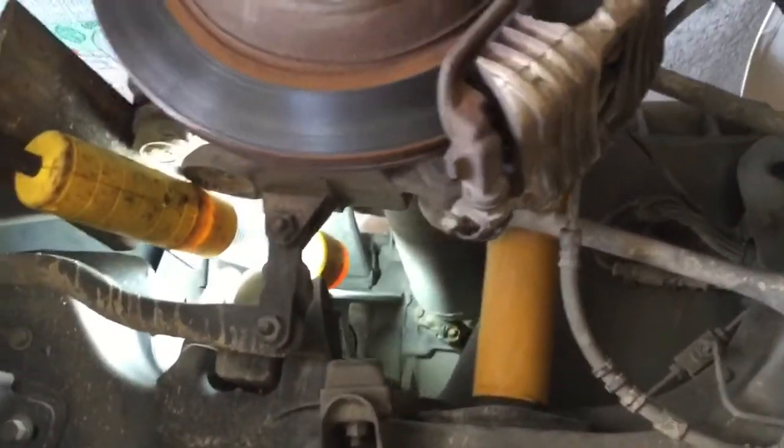Fiddling around with a cutting torch or grinder would have been a waste of time. I'll go ahead and set up this second one to show you how it goes. Three light blows and once that's done, you grab the bearing cap that's now driven through the yoke — it can be a little hard to get off, but there it comes. Pull the other bearing cap and at that point the half shaft is completely broken down. Now it's time for a lot of parts cleaning, so we'll pick up the video when we put things back together.